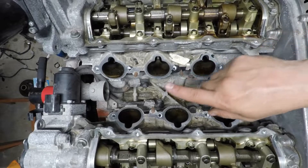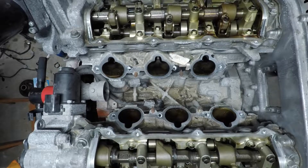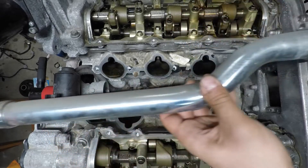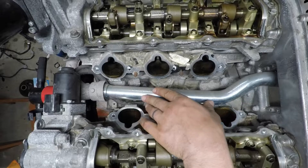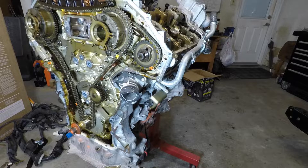Also, before we leave the area, this is where that coolant pipe from the front crosses over. I'll get it here just to get an idea of it, because there's some of this stuff you can disassemble in a different order. Here's your filler neck here, and it just runs through this valley underneath the lower plenum and slips in place there, so it's pretty simple. Now we're going to go ahead and finish up taking all the rest of the coolant piping and stuff like that out of the way.